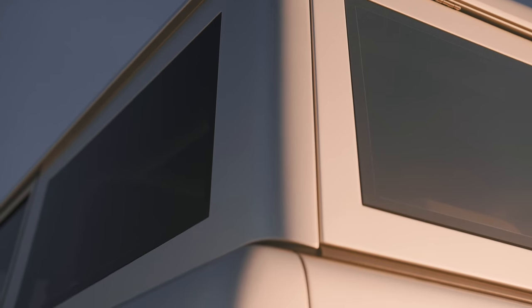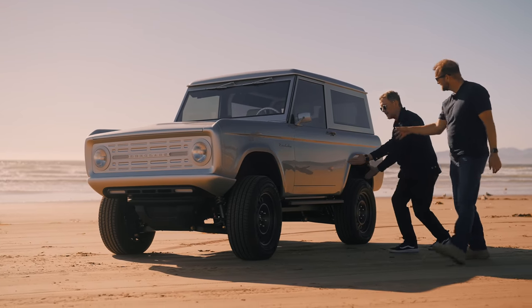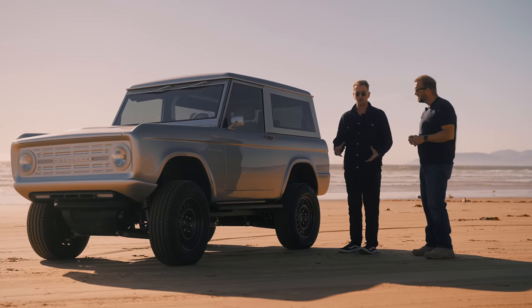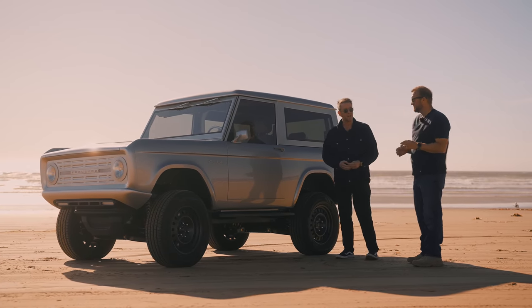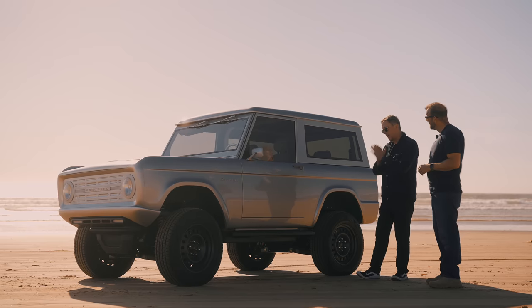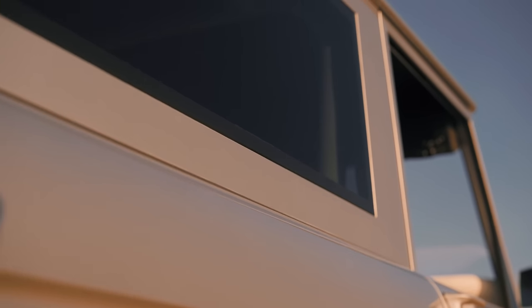So where's the battery gone? The battery is between the axles — between the front axle and the rear. It's perfectly centered, which is really where you want your center of balance to be for an electric car. If you put a bunch of batteries in the front, it's going to have oversteer and roll center problems. You put them in the back — same thing. We tried that and you felt the weight of every turn, which really affected performance and drive quality. So we said: what if we could balance it perfectly, not have anything get in the way of the motors, and let it be as efficient and as powerful as it can?